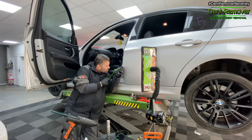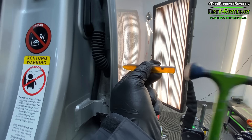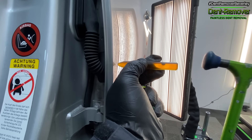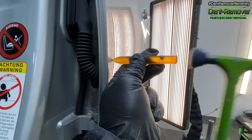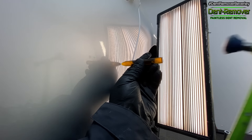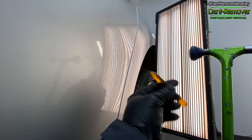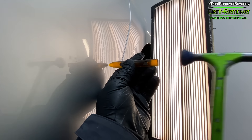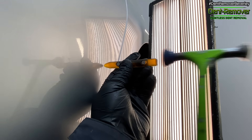The quarter panel wasn't the only panel damaged in the vandalism. The rear doors on both sides were also damaged — this nearside door had an obvious dent near the door handle, a mixture of soft dents across the main part of the door, and a sharp outward dent on the front caused by an inner brace protruding through the skin upon impact. This door took around two hours to finish off.